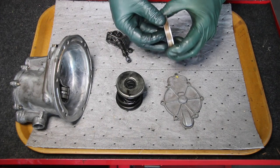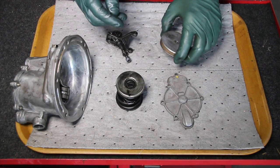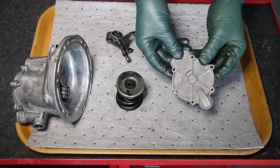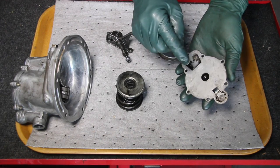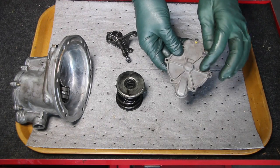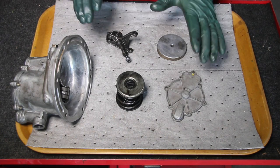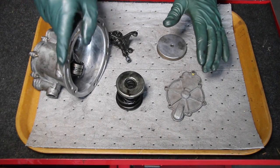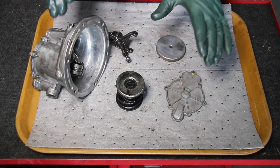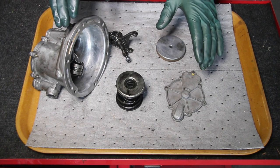We have good used pistons available with good sealing rings, which is a real plus because overhaul kits for these vacuum pumps are very expensive from the dealer. I've also seen cracked or damaged covers — when this bolt loosens up, the piston can come up and crack the cover. I have three or four good covers available. If you're looking for resources, instructions, overhaul kits, or used parts for your vacuum pump, visit mercedesource.com — I'll put links in the description below.